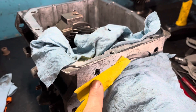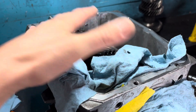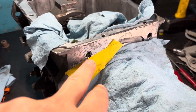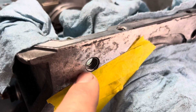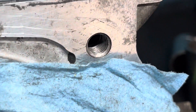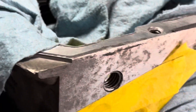Now this happens with the T5s. Every now and then I'll get one and this will happen. It's very frustrating. It really sucks because you have your top cover that's already on with sealant, then you put your tail housing on with sealant, torque all the bolts down, and it's usually this thread on the T5 specifically. Just how they designed the case — there's less threads on this hole versus this one. I don't know if you can see that. A lot of threads there compared to that one. So I'm going to show you how to repair some threads and put a helicoil in.